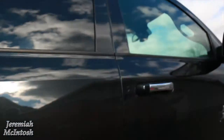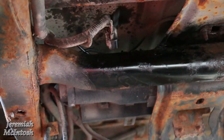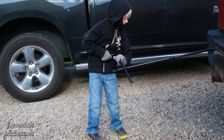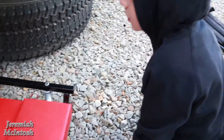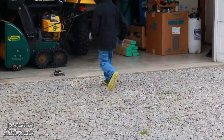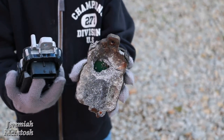The reason it goes bad is where they mount them — up behind the spare tire on the rail of the bed of the truck. Let me show you here — you can see I took it off and cleaned it up. It's held on by two bolts with a little plug there. The easiest thing to do is drop the spare tire down to get to it. This is on a 2005 Ford F-150. The backside of the module is aluminum and it's mounted directly to the frame of the truck.